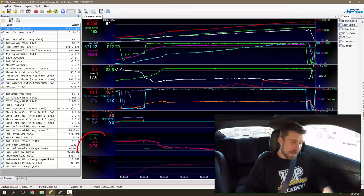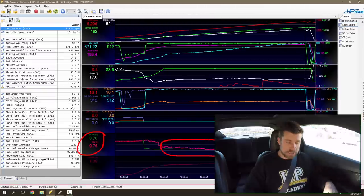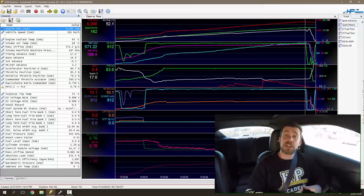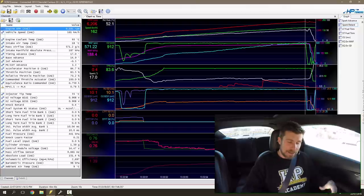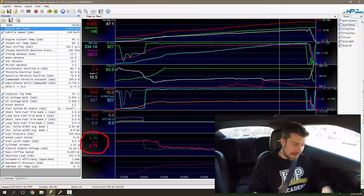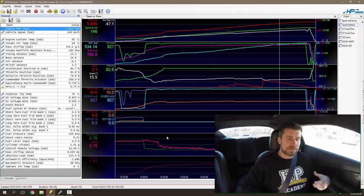We can see at the bottom we have our commanded air fuel ratio lambda versus our measured lambda. We're simply going to be looking at the data through this scan and seeing how closely our measured lambda matches our target. If our engine is tuned correctly, we're going to see that our measured air fuel ratio very closely matches our target. And you can see if I click through this particular scan, that's exactly what we've achieved - in most instances our measured air fuel ratio is within around 1% of our target. There is a little bit of lag right at the start of the run where I first went to wide open throttle, but that's to be expected.